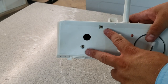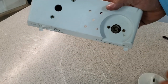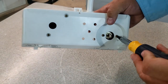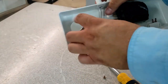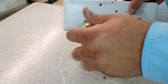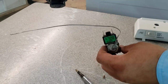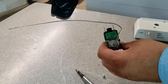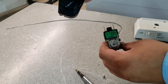From here we're going to take the defrost timer out as well as the thermostat. There are two screws on the thermostat, and if you remove this cover you'll find two more screws underneath. Both of these components are still good, so we can reuse them on a different unit later, or put them back in if this modification doesn't work out.